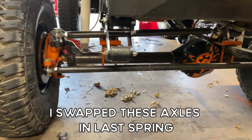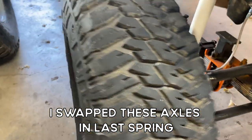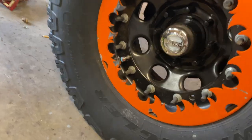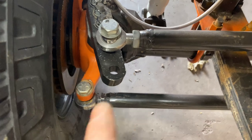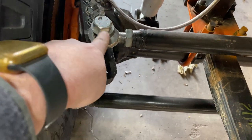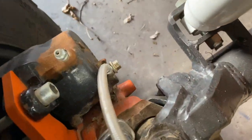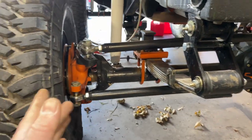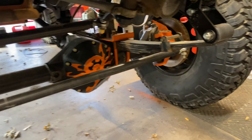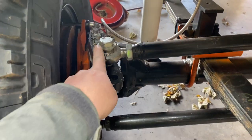What we have is a Dana 44 out of a '78 Ford F250 - this is the heavy-duty version, the three-quarter ton eight-lug version. I have these Reed knuckles. What's going on is I actually cannot hit my steering locks. I've moved this around, I've tried longer pitman arms, and what I figured out is that I'm hitting the steering stop on the back but not coming close on the front - and that's because of the Ackerman angle: one tire turns more than the other.